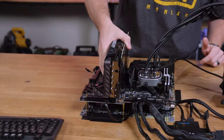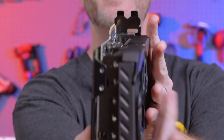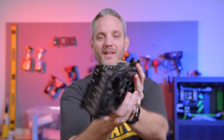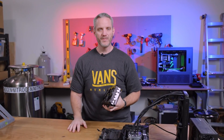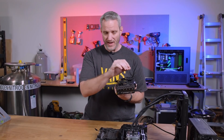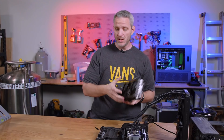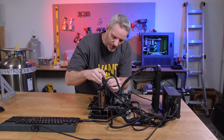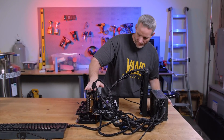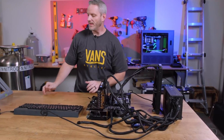Let's see if it even fits in the slot — it's crunchy. It kind of straightened the slot out but not the rest of the PCB, so look how misaligned it is. Our biggest concern with the bending of a board is whether or not it cracked or broke any of the internal traces — it's a multi-layered PCB — or potentially popped something off a solder joint. Most people would agree that graphics cards are not supposed to be curved.